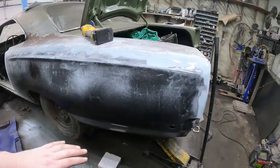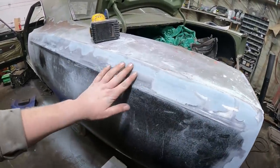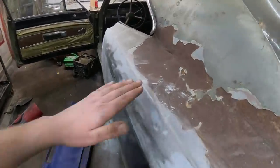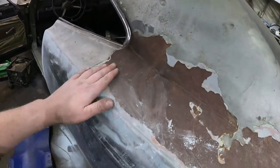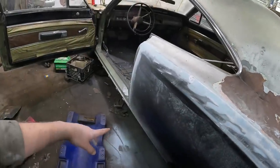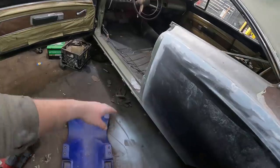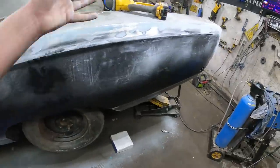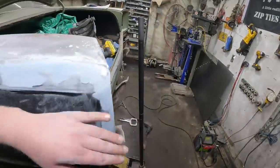I sanded this side down. You just kind of put a little coat on — I just want to cover the weld, seal the weld. I got to get in here and rough this all up. I'll just shmoo it full of filler. I got the downside down by the door and into the sill a little bit. I'm just working on that patch panel underneath a little bit in between doing some bodywork, and I'm really not filming it because it's boring.